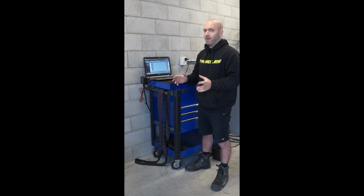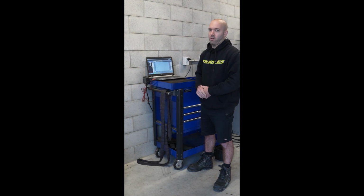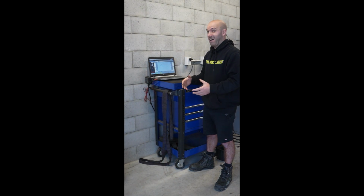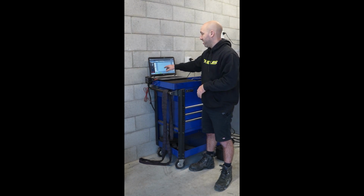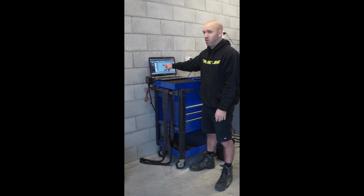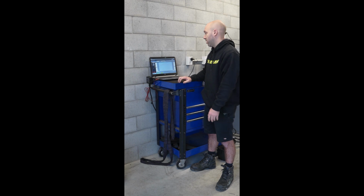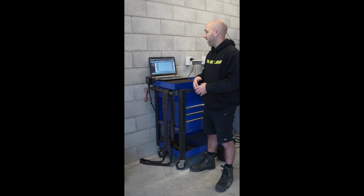We're using the same start time, the same everything, same ramp rate, tied down on the dyno the same way. The inlet air temps were within 1 degree, so we feel that the data is very relevant. We've gone from 6 psi at 2900 RPM to 10, and at peak torque we're running 13 pounds, so we're making 500 and something Newton meters on spring pressure, whereas before we were making the same peak torque at 15.5 psi. So we've lost almost 3 pounds to make the same total torque output.